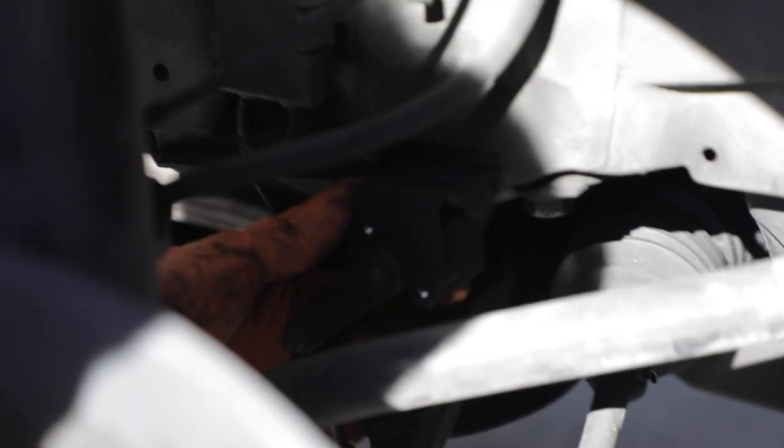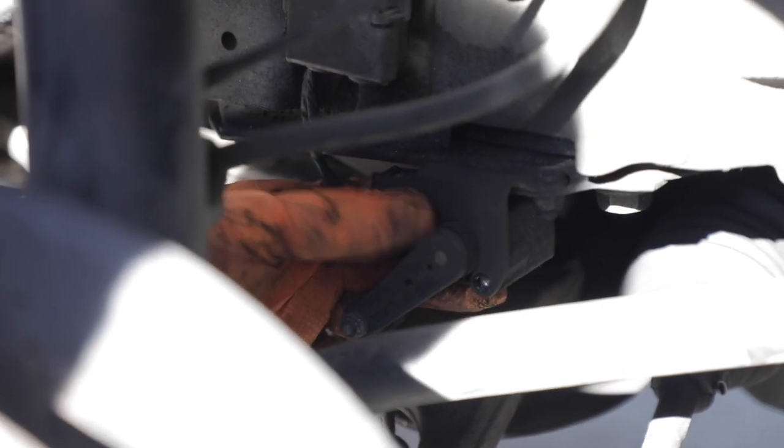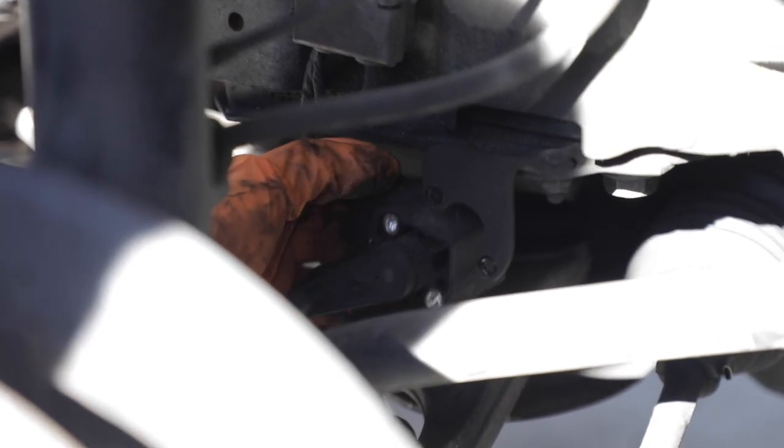So there's this headlight leveling sensor on the passenger side of the car. What I ended up doing was removing the two Allen bolts that hold this to this bracket. And I'm gonna disconnect the connector to it. You wanna disconnect it because if you forget to take this off, you'll most likely break off either the hinge assembly or bend the metal rod that goes to the control arm. I feel this is the easiest way to do this.